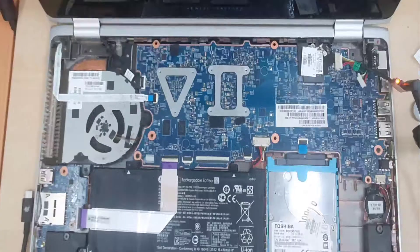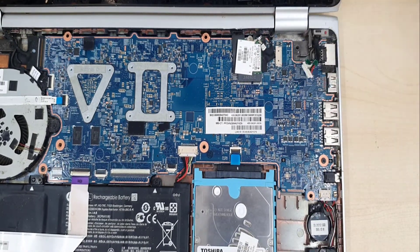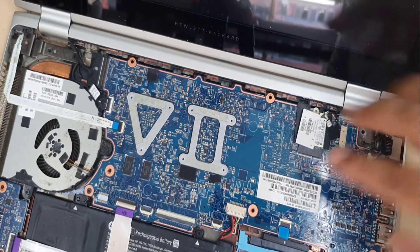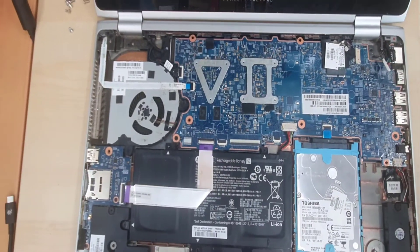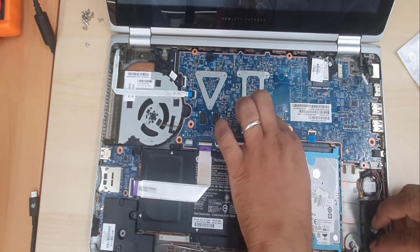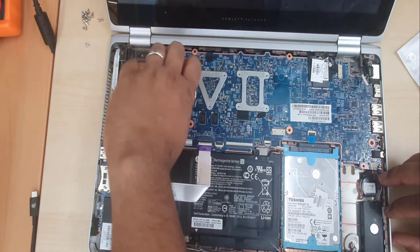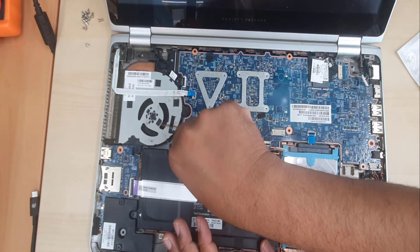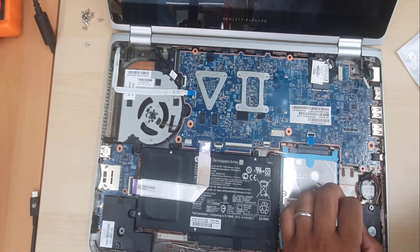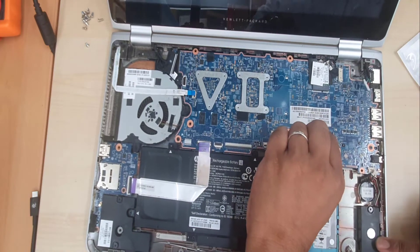So let's disconnect the charger and remove the battery. Then we'll remove every single cable flex — first disconnect the battery, that's the first thing. Then we'll disconnect the power flex cable, the sub USB port cable — whatever we can see — because we need to pull out the actual motherboard. Otherwise we won't be able to get access to the charging port. HP did a bad job on this model; they hid the actual charging port right next to the hinges. So disconnect all of them — even the hard drive connector, the secondary board connector, speaker, Wi-Fi antenna, display connector, pretty much everything.